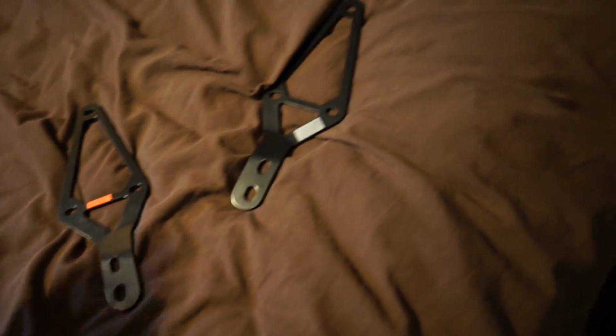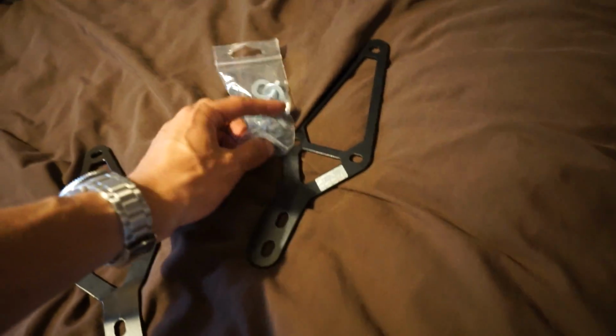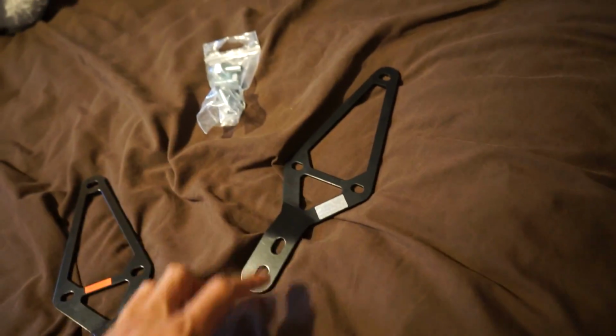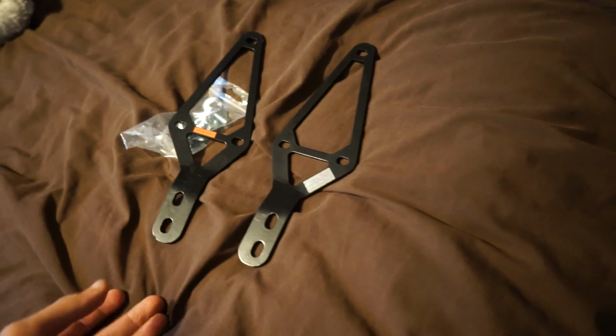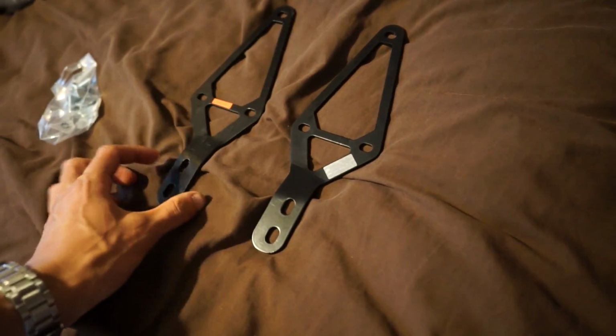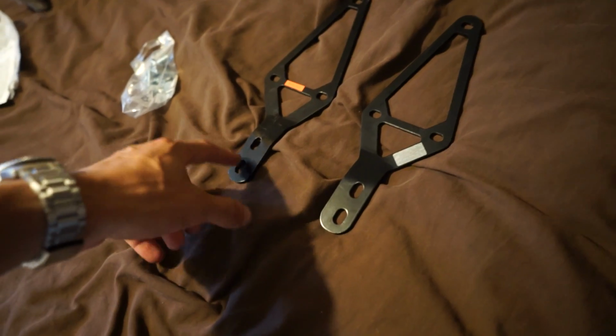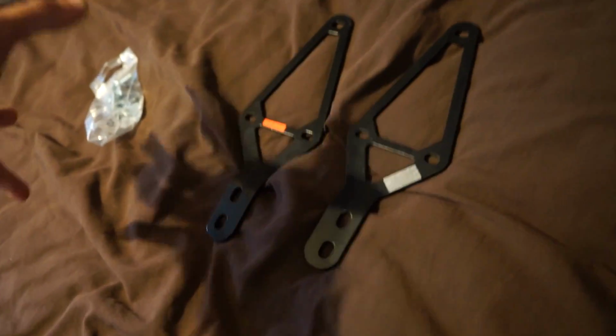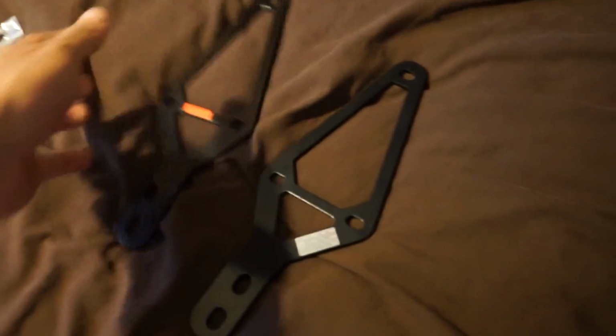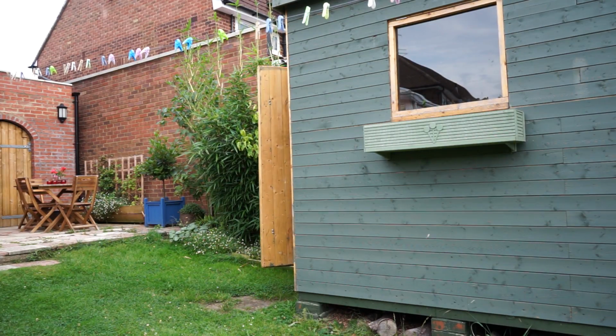And so the idea here, so I bought these bolts as well to make my life a little bit easier, so I can just use a standard spanner, and I can just basically do these up into the car when I want that hardtop roof on, and then when I want to take it off, I can take them off. And you can very easily fit, I reckon, a spanner in between the seat and where these will slot into the car, much easier than you could fit like an Allen key or a Torx wrench as it previously had in there. And also obviously these are thin enough that they'll easily fit in between the seat, whereas the brackets won't, which I'll go and show you now.